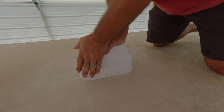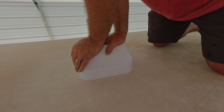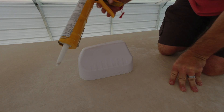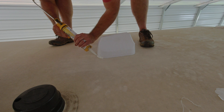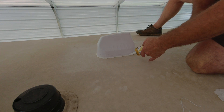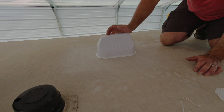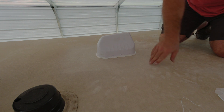We're going to press on it here for maybe 30 seconds and get it nice and flatly adhered. That feels nice and strong — I like that. I'm also going to take some Dicor and go around this thing with some Dicor to seal it up. There it is — feels pretty good about that. That is nice and solid and I believe it's sealed up as good as you can possibly seal it. Now we'll go back inside and finish up inside.